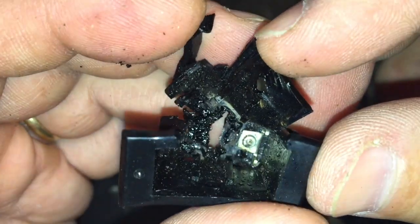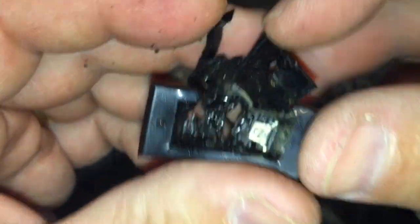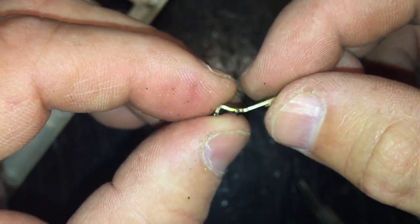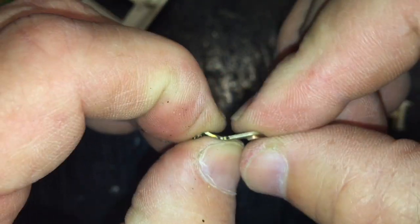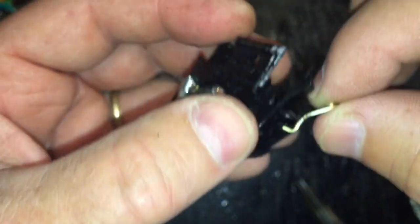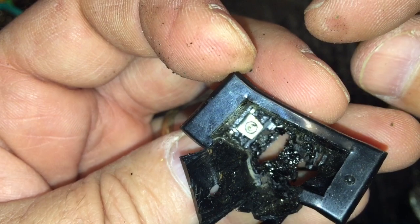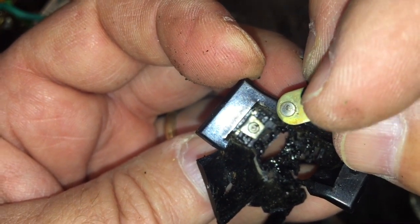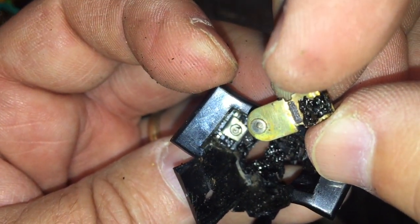That end really doesn't look super bad either. I mean, if it arced at all — I think this is supposed to be bent like that because it's part of the rocking action that's in there, so I don't think the heat melted anything like that. It must have been just enough sticking together and enough junk in the middle where it kind of arced and didn't really make a proper connection, but then again didn't heat-weld either — so it just melted the housing.